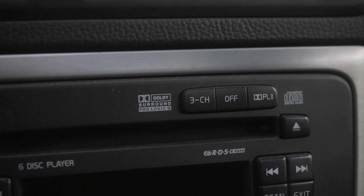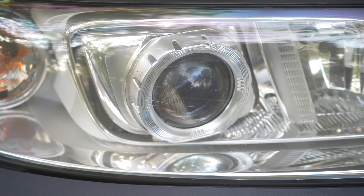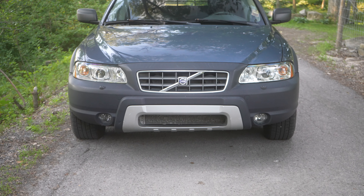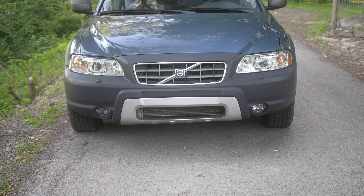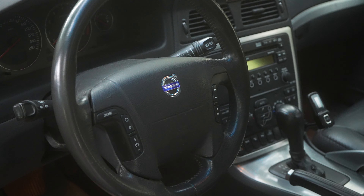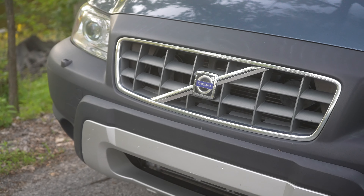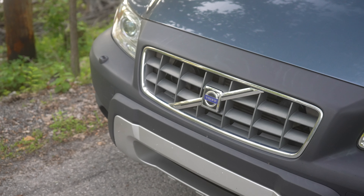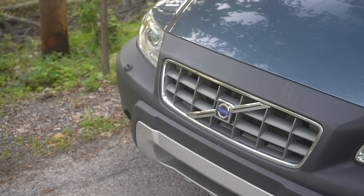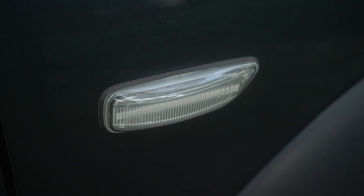So with the lift kit, I'm going to get 17-inch wheels so I can fit the Brembos from the R. I'm also getting the 330-millimeter disc to go with it. All of my old hybrid turbo kit and R engine is going to go in the XC70. It's going to be roughly 400 wheel horsepower. I'm going to have to do a 3-inch downpipe and then a full 3-inch exhaust as well.